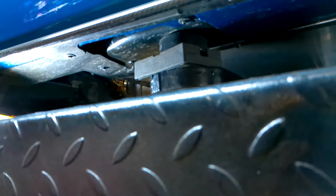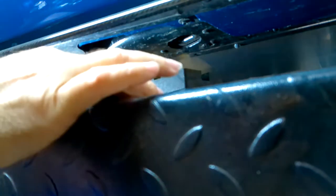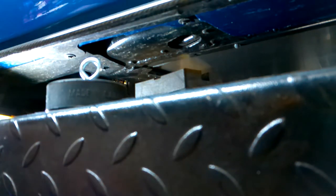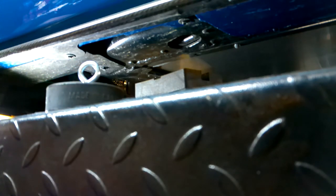When I drop that down, the hockey puck should stay in place. To remove it, spin and drop it out — and you've got yourself a set of jacking pucks. All you need is four of these eye bolts, four hockey pucks, and five minutes of your time, and you can have yourself a set of jacking pucks for your car.